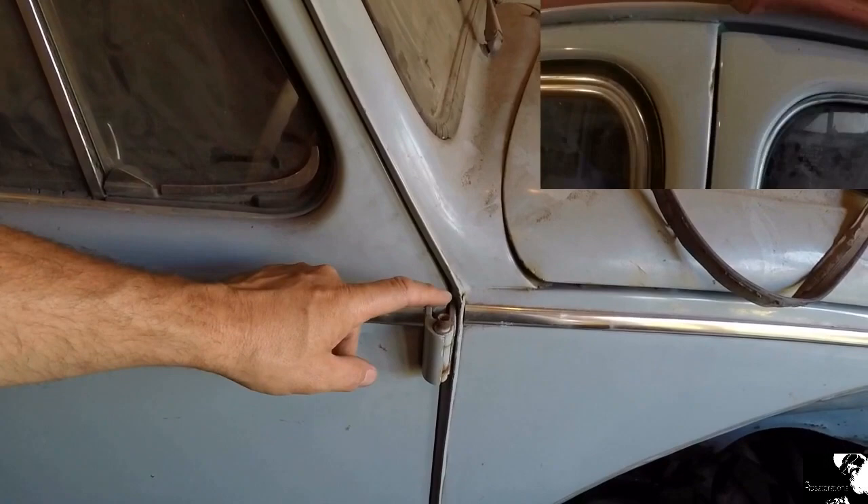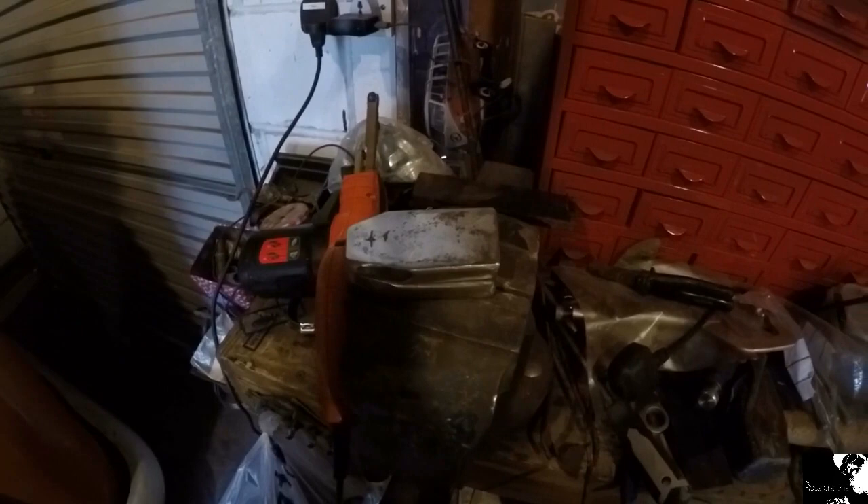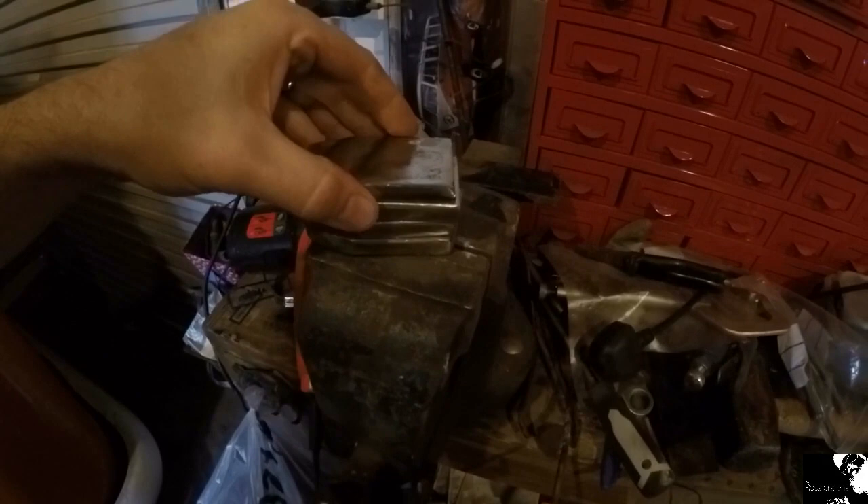I think I'm going to have to make a homemade tool to actually try and pull them out. This is what I've currently got in the makings of the hinge pin removal tool. Got an old bit of plate there and I've cut a few of those down already to size — done four so far and need another two. The idea being I'm going to weld three together to make a thicker plate.